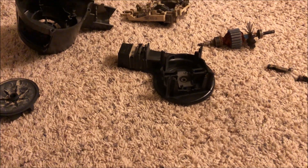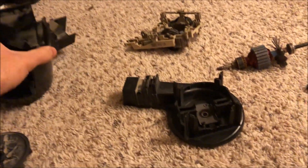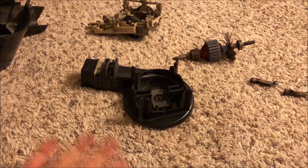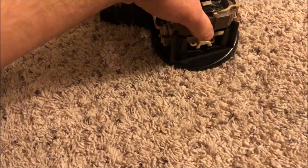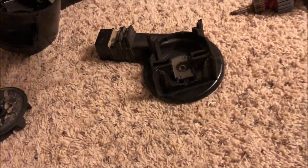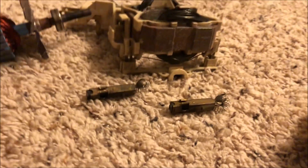So how to take the motor apart — unfortunately I forgot to pick up the camera and show you how to take it apart. But an easy way is when you pull off this motor housing it exposes the field windings and the armature. Basically what you're going to have to do is pull out the carbon brush holders, which actually hold on the field windings, and then the motor will just slide off, because the carbon brush holders are the ones that actually hold down the field windings.